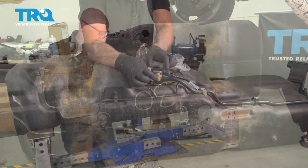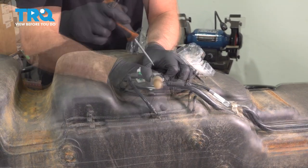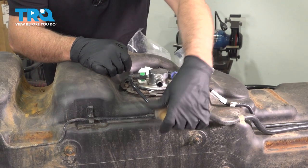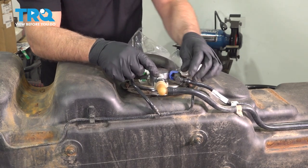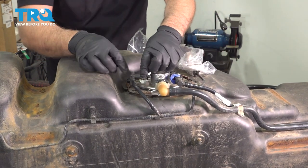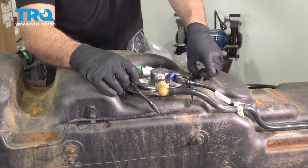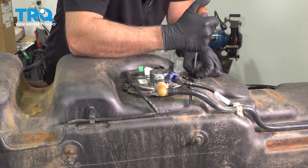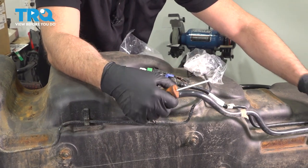There it is. I'll disconnect the hoses — just squeeze the two tabs on the side of this hose. If it doesn't come off, you might need a pick or a screwdriver. Just get behind the tabs and you can slide that one off. There's a lock ring that holds this on, or a lock tab — slide that back, take that one off, and do the same on this one. Slides off and out of the way. Just gonna move the hose out of the way — it's clipped in right here. Just use a straight blade screwdriver. These are clipped in over here as well — you can move those out of the way.